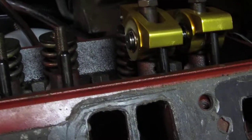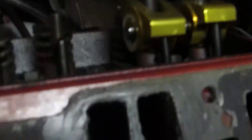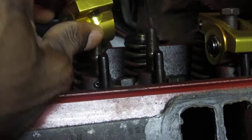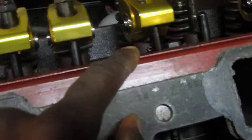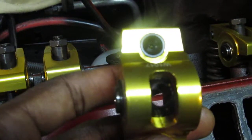See all these right here — I already repaired these, got the clearance issue straightened out on them. But I got these last two right here, and as you can see, the bottom base part of the roller rocker is hitting on the stud guide right there. The bottom right here is riding right on the guide stud, so I'm going to show you how I repaired that, how I fixed it.